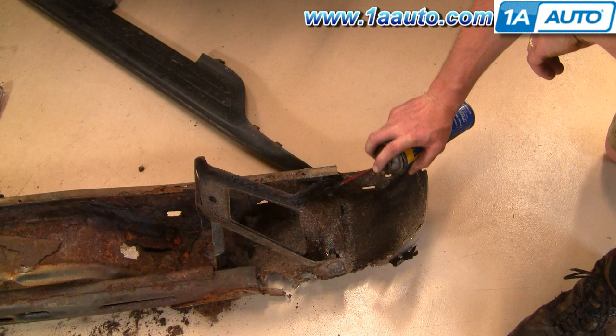I'm going to make an admission: I was not able to get any of these bolts apart. My bumper was rusted so badly that I just couldn't use wrenches — I ended up having to cut them off with a torch. There are 10 of these bolts in all: two each holding each of the side brace brackets, and the large reinforcement bar that goes across the middle has six holding it. I purchased new galvanized bolts from the hardware store. You'll need a torch or a sawzall to get those out if your bumper is as rusty as mine was.